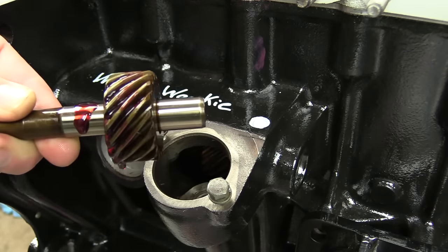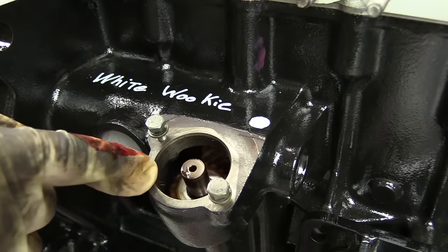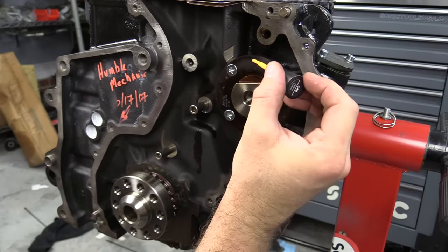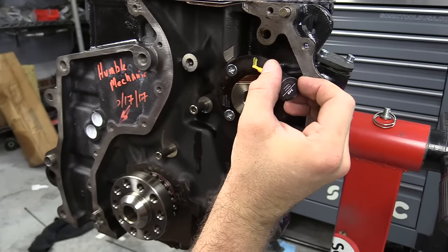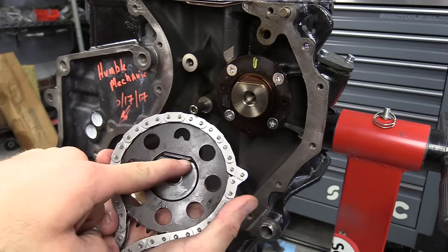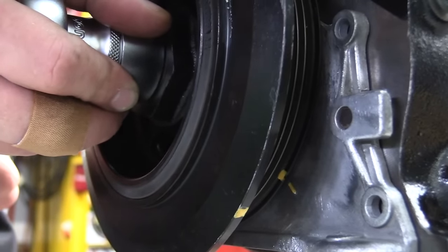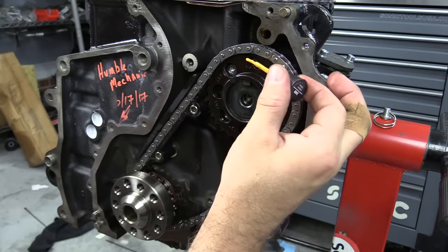If it's not already installed, go ahead and drop in the oil pump drive gear — we're not going to bolt that down because we're going to use it to prime the oil pump. Next, it's time to put on the chains, starting with the lower chain. You'll notice on the cover for the intermediate gear there is a notch right at 12 o'clock — I like to paint that to make it easier to see. You'll also notice on the shaft there's a flat spot, and we want that flat spot at the top. Before putting this lower chain on, we do need to bring our crankshaft back to TDC and make sure our shaved-down tooth as well as our marks in the front all line up.